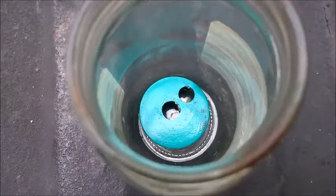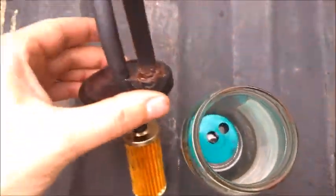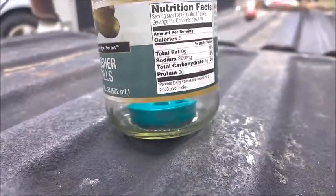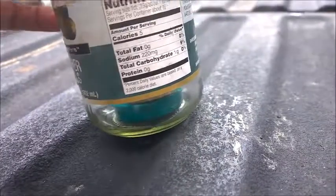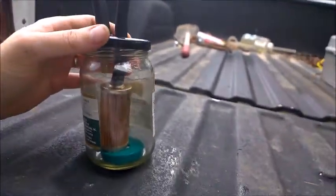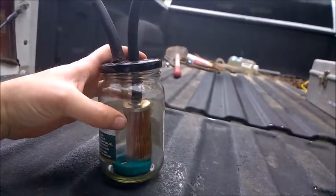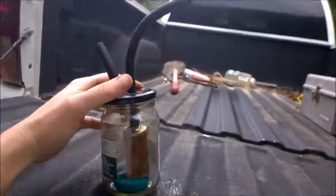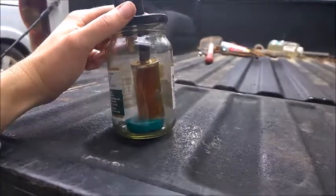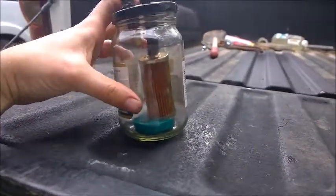I put another small plastic lid from my first attempt in a smaller jar — that hole in the middle was just a little bit too large and the fuel line did not fit as tightly as needed and it leaked a little bit. So it's going to be a spacer down here to make sure the fuel filter sits off the bottom and isn't just hanging, which would risk it coming loose. When this gets tightened down we'll have a good liquid-tight seal, and fuel comes in here, drips right in, fills up the jar, goes through the filter material, and out of this hose to the engine. You need this type of bowl filter for a diesel engine, as opposed to the normal inline filter you may use on a riding mower, partially because you need space for moisture to drip and settle down at the bottom.